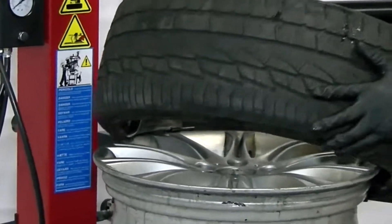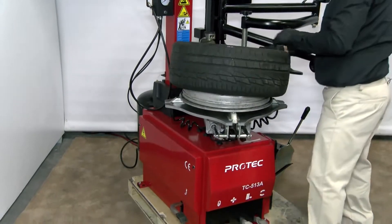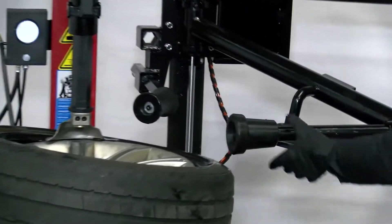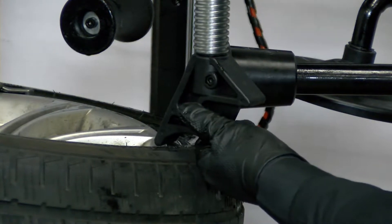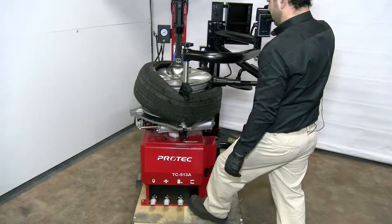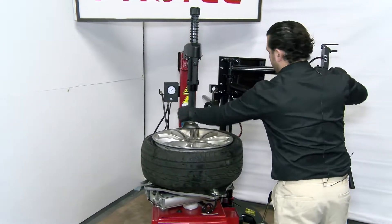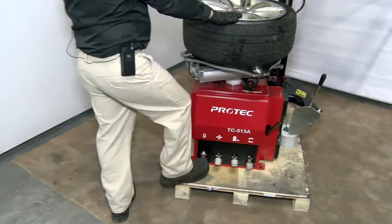Watch for the tire inside/outside orientation — asymmetric tires or directional tires. This is going to go over the demounting head to mount the tire. We're going to use sometimes two, maybe three, or all three arms. Make sure one is slower than the other. As you're going around, bring the arm up so it doesn't interfere with the bead and damage the tire. Get everything out of your way, then tilt the arm back.